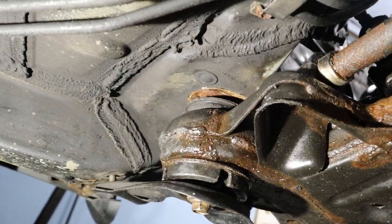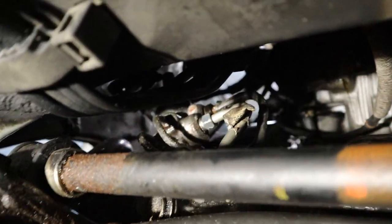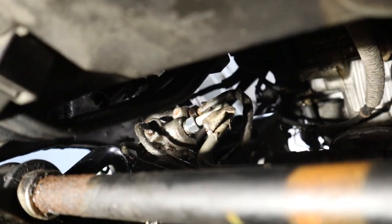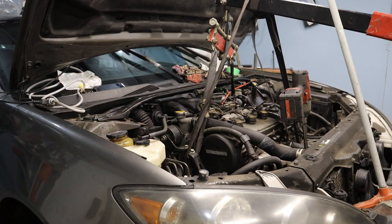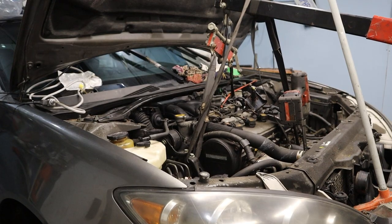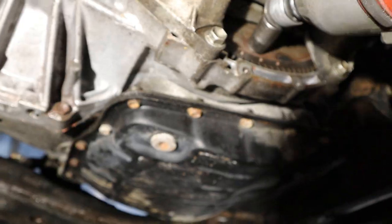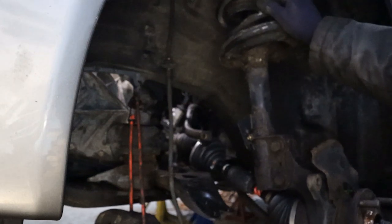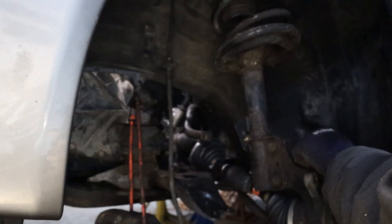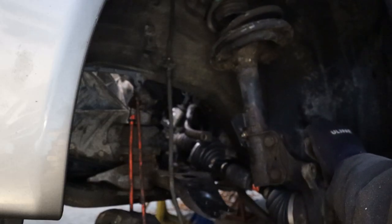I got my subframe bolts all caught up inside. Before raising the subframe I was able to sneak in there and get my power steering lines connected, which was quite a difficult job. With all the engine mounts lined up I can go ahead and release the weight of the engine onto the subframe. Next I am putting in the flex plate bolts and tightening those down. Now on the driver side I am replacing the knuckle and the shock that I removed to give extra clearance to get the transmission in. I put a new boot on here, so I am just going to use some of the grease that came in the kit.